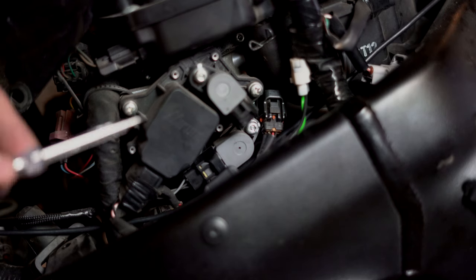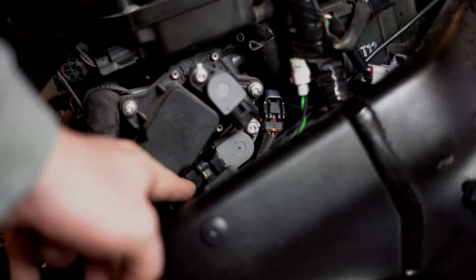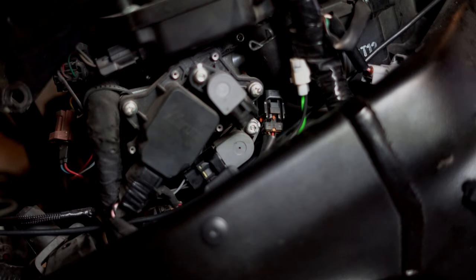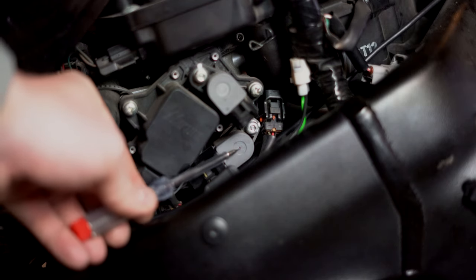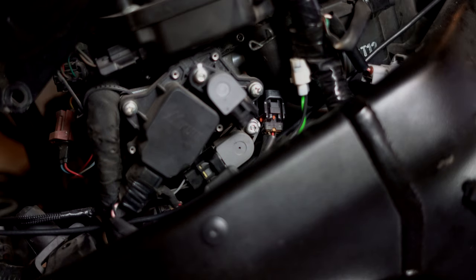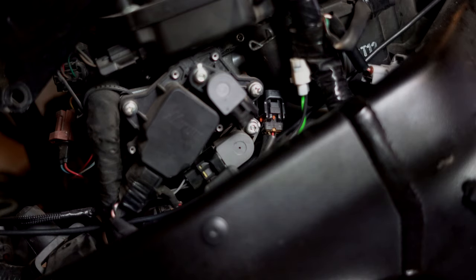The piece that you're actually going to be adjusting is this gray sensor right here connected to this black piece — you adjust it by either pushing down on it or pulling up on it. You have to be careful because it's very sensitive, so you need to make micro adjustments. You cannot adjust it without first loosening this screw right here with the Security T25 bit — you don't want to take the screw all the way out, just loosen it enough so this has some range of motion. Then turn the dash back on and monitor that line next to the C as you push down or pull up on the sensor, until you get that sweet spot where the dash is right in the middle of the C.